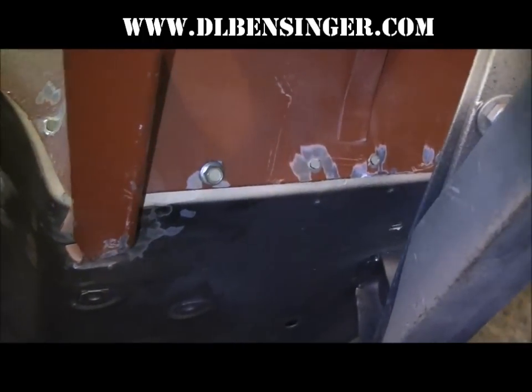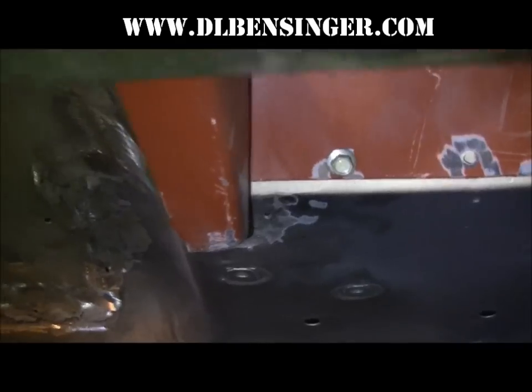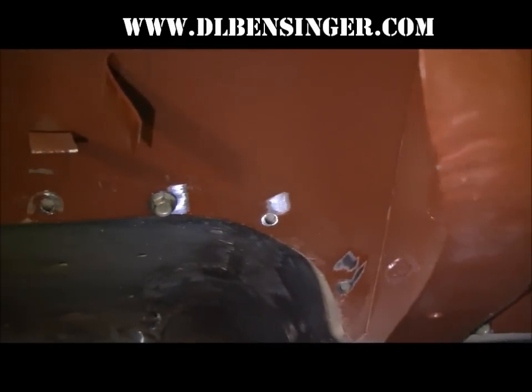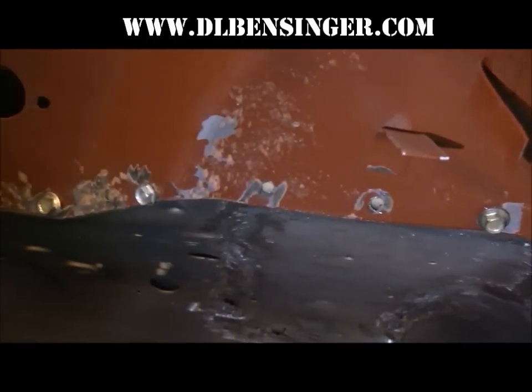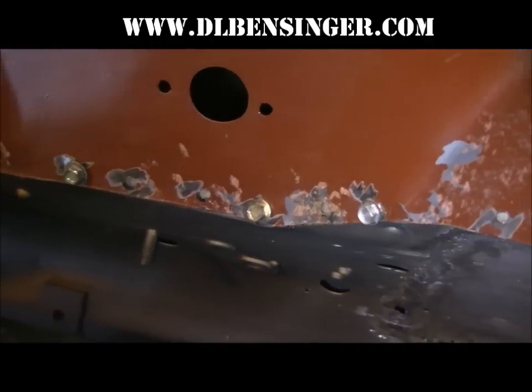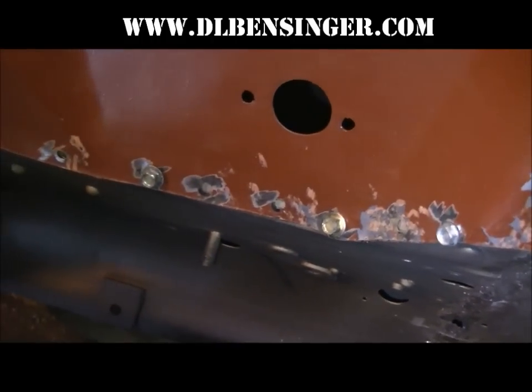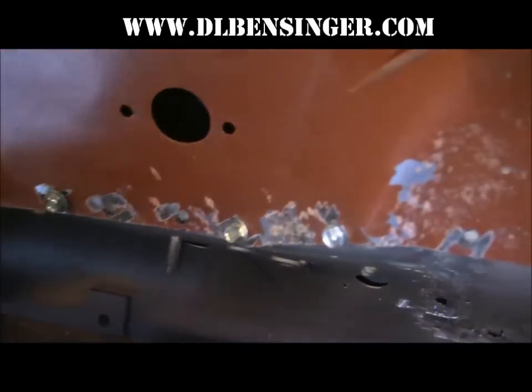Here in the firewall, they're particularly handy where it's real hard to get a clamp. You'll see that, as we discussed earlier in the project, all along areas where it's real hard to get a clamp in, we've gone ahead and used these sheet metal screws after we've drilled those holes and punched the holes that we're going to weld through. This has brought the parts together pretty well.